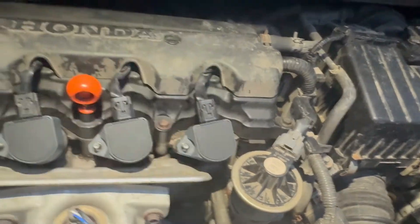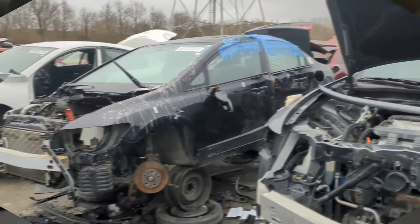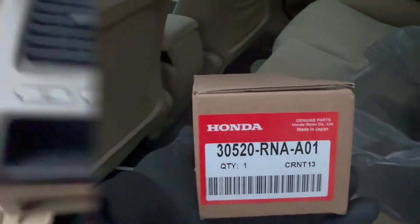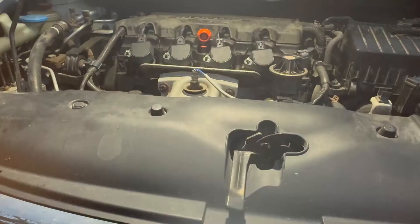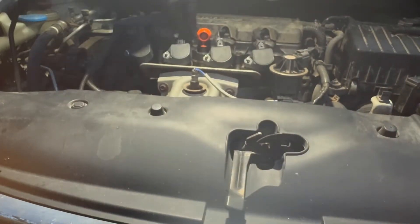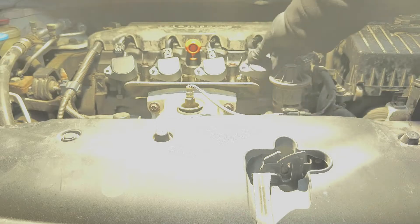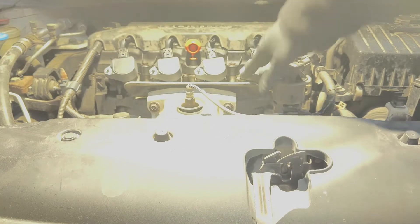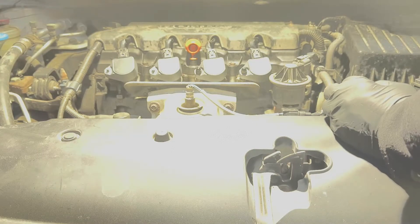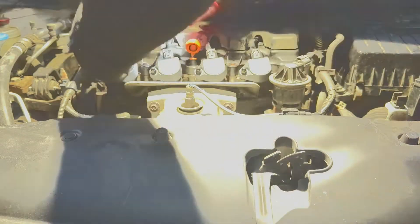Note that it's almost never the spark plugs. I need to replace this ignition coil. The ignition coils in this vehicle are aftermarket, so I'll be replacing all four instead of just the bad one. You can get four used ones at a junkyard or buy new ones like I did — I bought new genuine ignition coils and will put links in the description below. Installation is the easy part: turn off the vehicle, pull out each ignition coil, insert the new ones, install all four nuts and torque to six foot-pounds. It might also be a good idea to replace the spark plugs, but I'll do that another time.